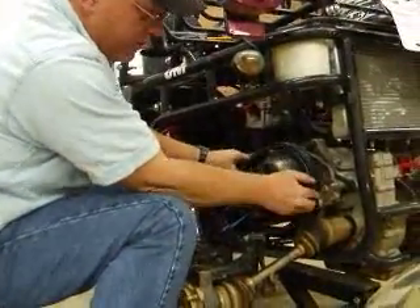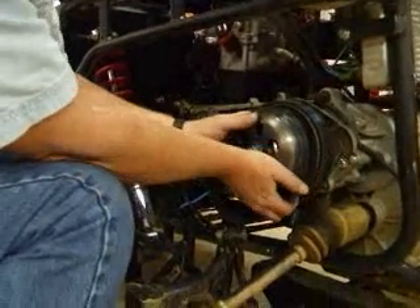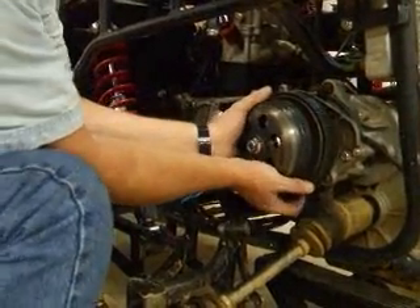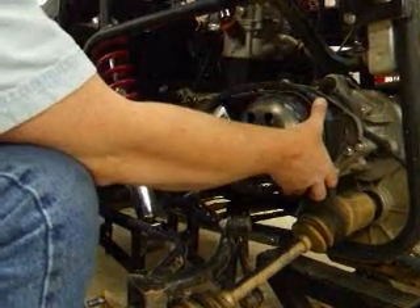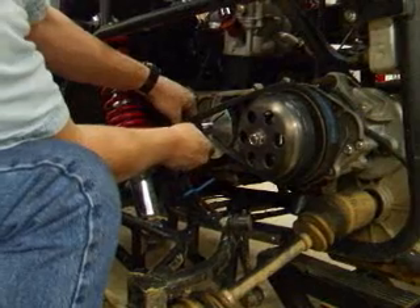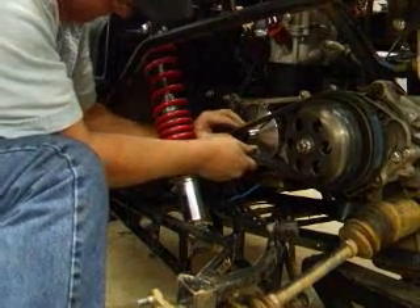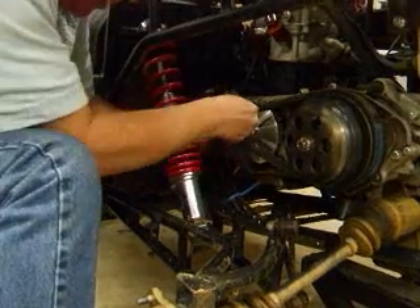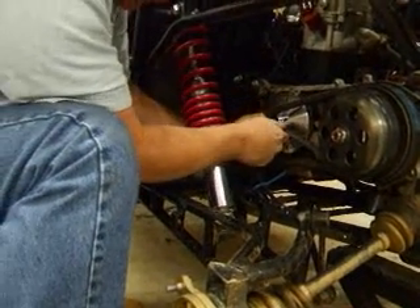When you put your belt on, put it in your slide pulley. A little trick is to squeeze that a little to get the belt to go down inside there to give you the room to slide this on the variator side. Your belt should be pretty tight to go on there — it shouldn't go on real loose.